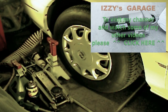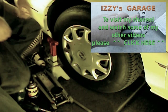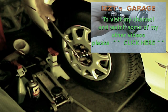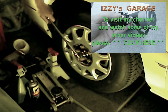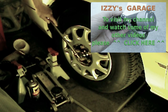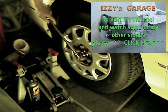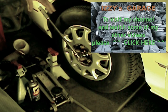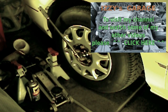Okay, today we're going to be replacing a hub and wheel bearing assembly on a '98 Buick Century. So we're going to first loosen the nut. Another way of doing it, if you forget and you raise your car before loosening this nut, is to have an assistant step on the brake. That's another way of making it easy on you to loosen it.